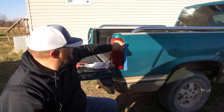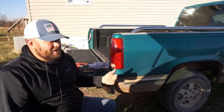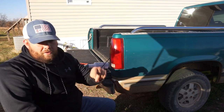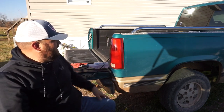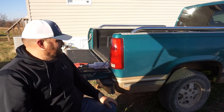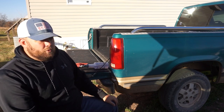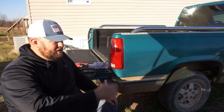Take your time — it doesn't take that long to do it. Remember: judge how bad the tail light or headlight is, then do one, two, or three passes with sandpaper after you clean it. Then compound it, polish it, and seal it. This Griot's Garage sealant could probably last six months to a year, so if the only thing I have to do is reseal it once a year, that saves me money. These tail lights are probably $150-$200, and it only took me 20 minutes.